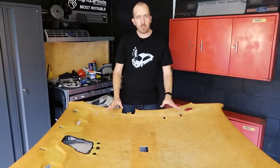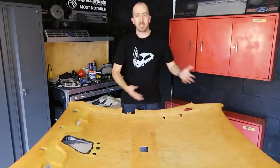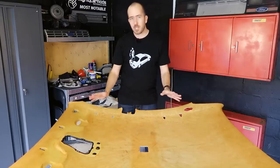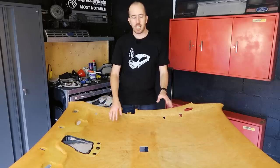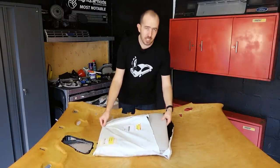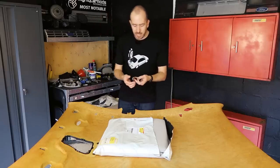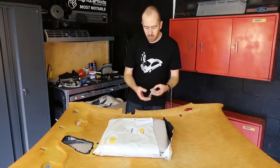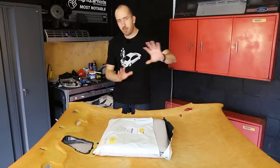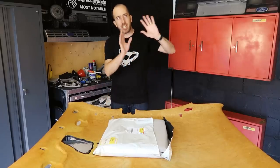We've got our headliner backing looking pretty good now. If you've done a proper job you shouldn't have any traces of orange foam left — it took me probably about 45 minutes to get it looking like this. When it comes to replacing the material on your headlining I always recommend sticking with the existing colour. The AU Fairmont's headlining was light grey and I found a kit on eBay specially designed for headliner replacement with a grey fabric on the outside and foam backing underneath — it's almost an exact match to the original. I really think headliners look great when matched perfectly to the colour of the pillar plastics rather than going black.